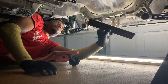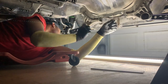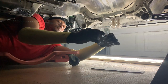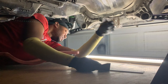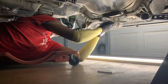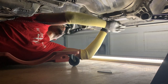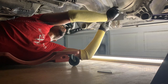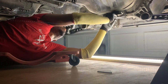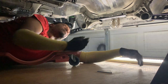This is the measurement for the brace that you put here from the S1 kit. That's one piece. It's another piece, but these pieces kind of mirror each other, so I don't know what the other one is right now. But theoretically, this is the distance you need to measure. So I just basically put it up there, marked, put it on the side, marked, and same thing on the back end. And I cut it out. There's the fit. You kind of see, it sits up there.